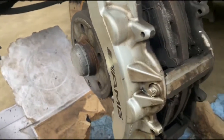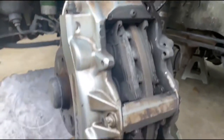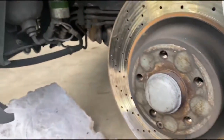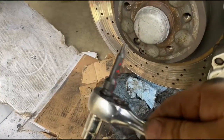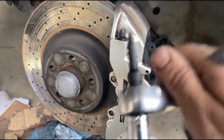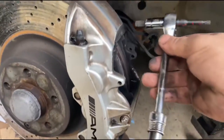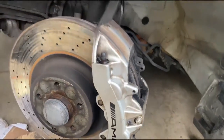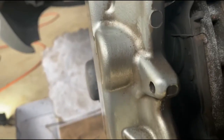The fronts were a little different — there was only one pin holding in each side. I already removed them. On the front, it's a T30 torx, and then it's a 10mm Allen to take the caliper off on the backside. Just a little bit different setup, but pretty much just as easy. And as you can see, those ones were done.